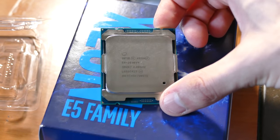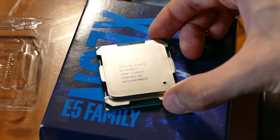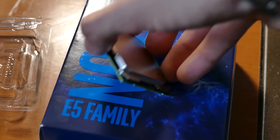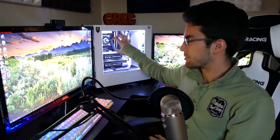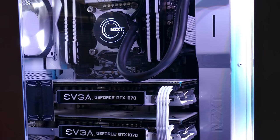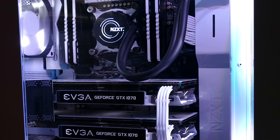It turned out there was some kind of CPU seating issue. I put it in correctly - look, this is my first X99, so I kind of didn't know what I was doing. But once I removed the CPU and reinserted it the exact same way - I'm telling you, the exact same way - I just pulled off the water block and reinserted it. That was really it. Once I did that I started getting POSTs and I got readings from Dr. Debug telling me everything was okay. In terms of the science behind why that happened, I have no explanation - maybe there just wasn't one pin contacting the CPU, just improper seating on my part.